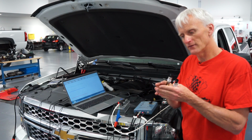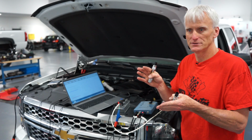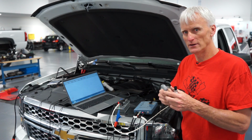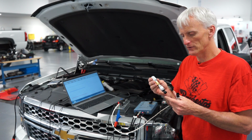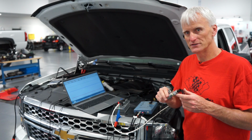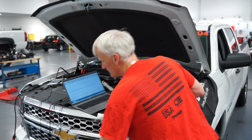You're still spanning 4 volts, between half a volt and 4.5 volts, but you're measuring only 300 psi, whereas on this one, I'll be across those 4 volts measuring 500 psi, so my accuracy might be a little bit off on this. But if you ever see yourself going over 300 psi, you're going to need something bigger. You can get the 500.